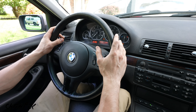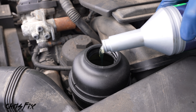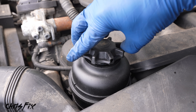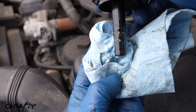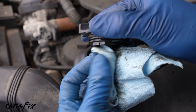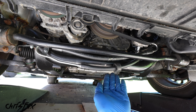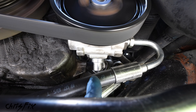Check the power steering fluid reservoir and top it off. All the fluid was sucked into the pump and lines, which is good. In total we used three 12-ounce bottles to do this job. Don't worry if the fluid looks frothy — that's just new fluid getting churned up by the pump with air still in there; it'll bubble out over time. We're filled all the way up. Now go under the car and check for leaks — do a quick inspection and look for any drips. The fittings at the pump are drip-free, so we are good to go.